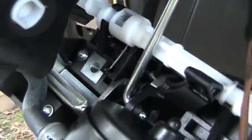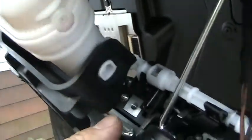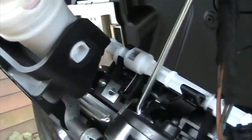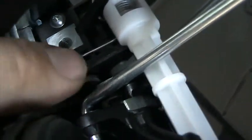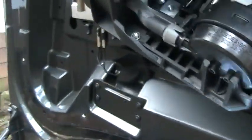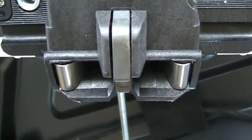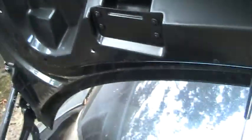What is not happening anymore — and I guarantee, I promise you, this was happening — is when I would hit the button, not only would this plunger actuate, but the soft close was actuating also. All this goes down in here. There's a metal lever, and that metal lever down in there touches another metal lever in order to actuate your soft close and pull the trunk all the way down. That way, your second latch — the second detent of your trunk close latch — goes from one to two.